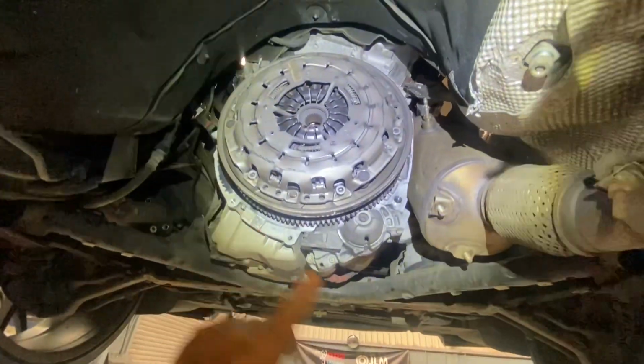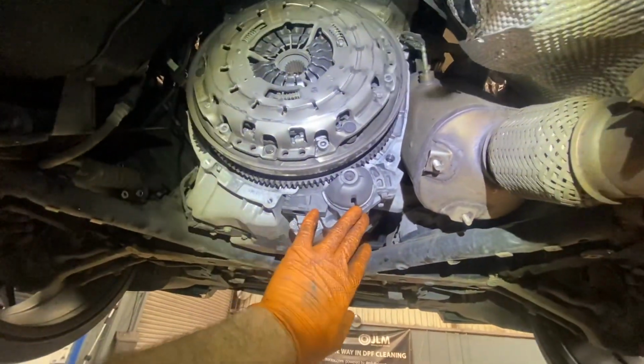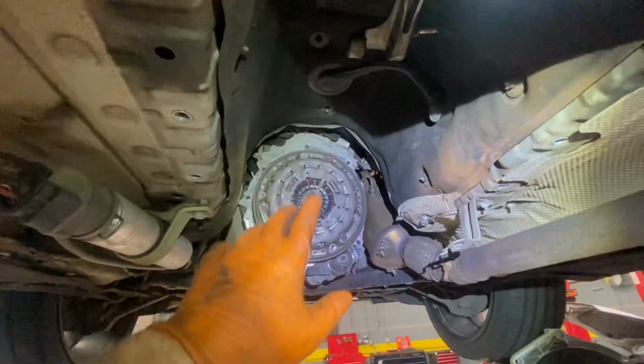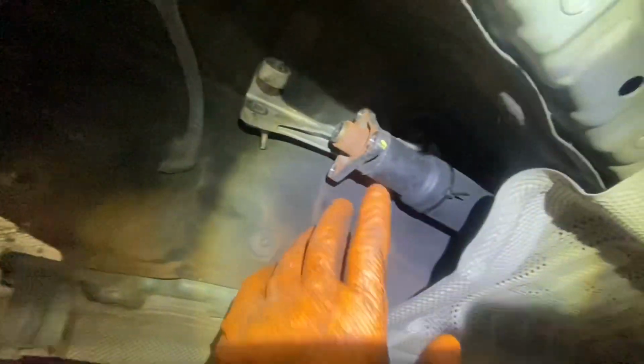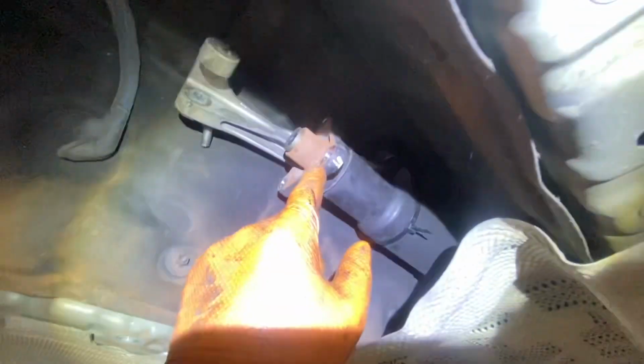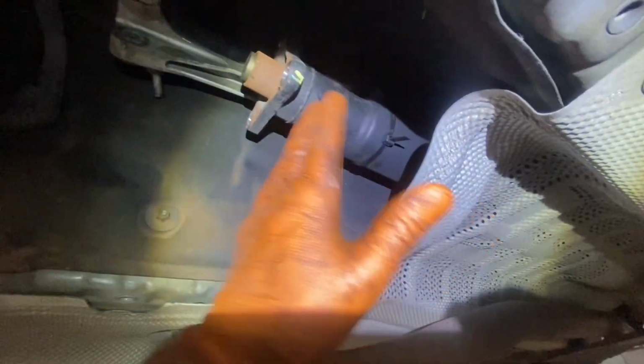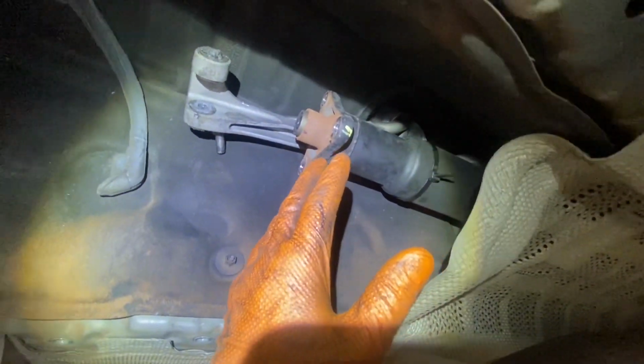I suppose the first thing I'm going to point out is the starter motor stays in place on the bottom. There's a rank of bolts sitting around the actual gearbox itself. On the drive shaft on the back, I just take out the 6 bolts out of the drive shaft itself. And that donut, as they call it, the shaft will slide slightly back out of your way. Once the donut has gone off, there's no bother.